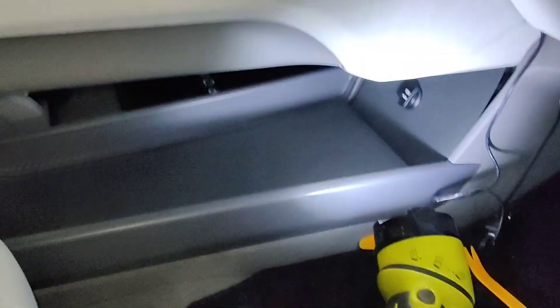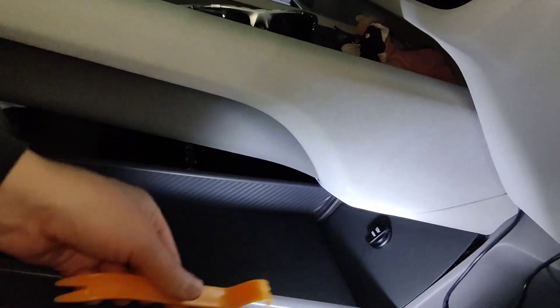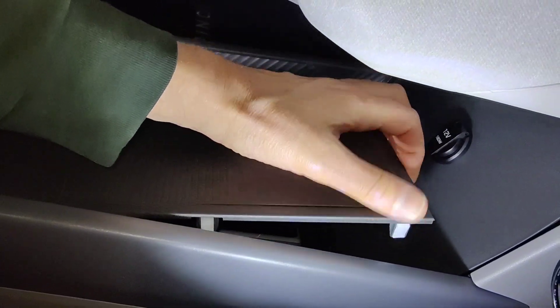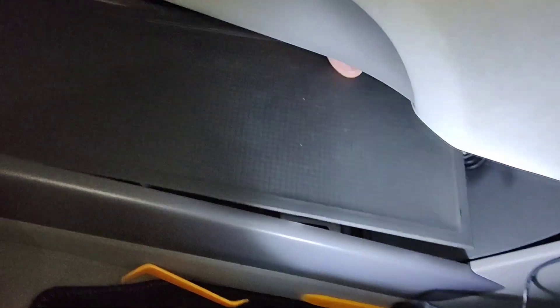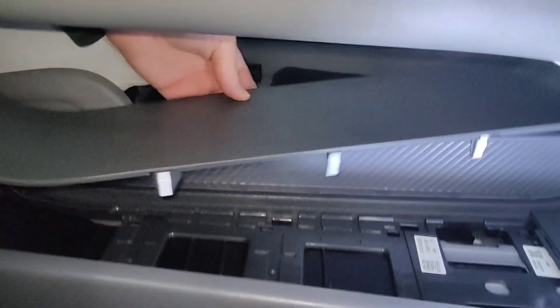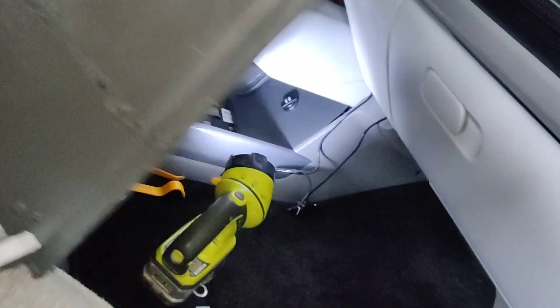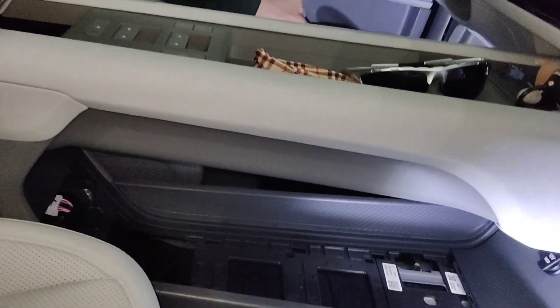I've already done this and I'm going to show you how. You'll want to use proper plastic pry tools — nothing else. Start by removing the base trim at this end, just peel it up right on the edge. You can see it's held in by clips. Pull it out from the other side and work your way along to the back. I'll show you where all the clips are — there they all are, plus two near the back. The very back end kind of slots in, so start at the front and work your way to the back.